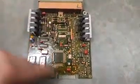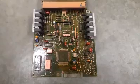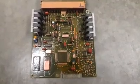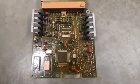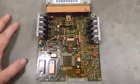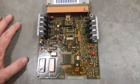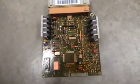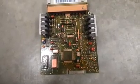Get them and have a professional electronics repair guy install them, because all this board is covered with conformal coating and it's not terribly easy — not a do-it-at-home solder job in my opinion. You're better off either sending it to a PCM rebuilder, which runs roughly $150, or taking it to a local electronics repair guy who is very good with this stuff and not afraid of the job. Like almost every other Fox body I work on, this thing needs three capacitors. The '94-and-up computers don't have these capacitors, but all Fox body computers — these capacitors are about 10 years past their life expectancy.